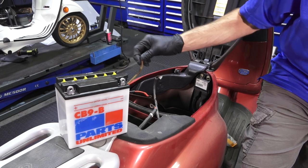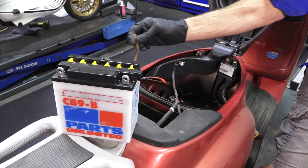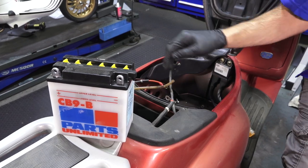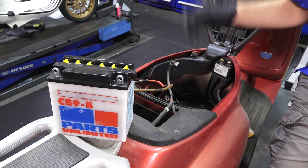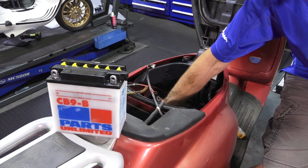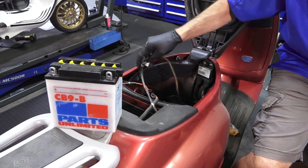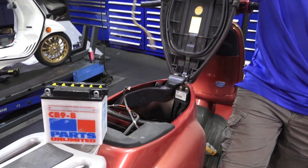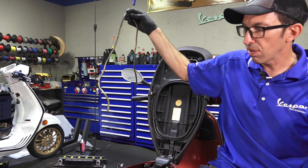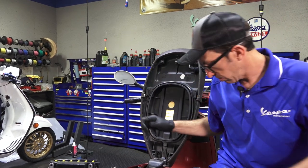Things to look out for with these conventional batteries: they do have a drain hose on the end, and so many people forget to hook that up. The worst thing it does is it oozes acid and vapors out, and it starts corroding the frame and the wiring — it makes a complete mess. This hose is like a rock, so we're definitely going to get rid of this hose. You want to make sure these old conventional battery hoses are vented away from any metal or wiring parts.